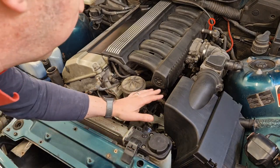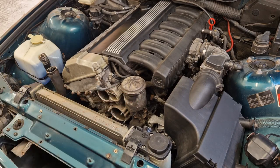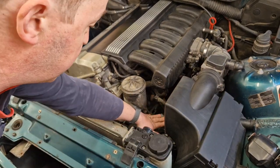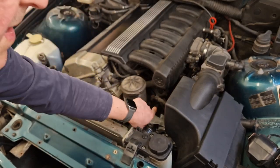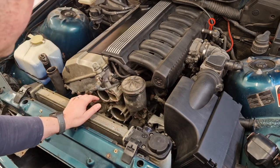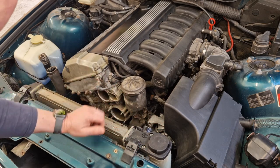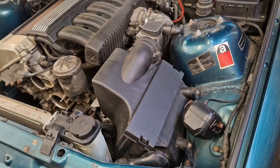In order to remove it, there are a number of things we need to remove — some of which I've already done. There's a pipe that comes over the top here which you'd need to remove. Then we're going to need to remove the airbox, the alternator which is back down here. Once all of those things are out of the way, I can get access to the six bolts needed to pull this filter housing off and replace that gasket. You'll also likely need to remove the radiator cowl and the fan clutch assembly, but those things are already done because I'm in the middle of another job.